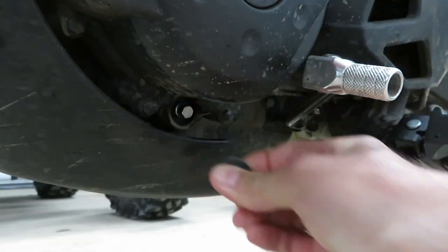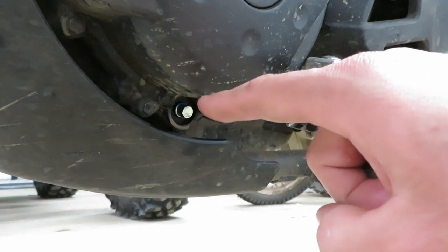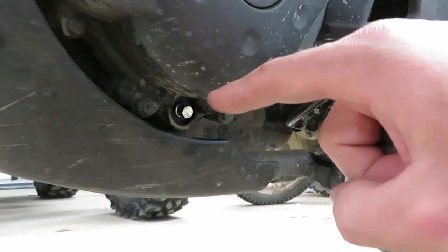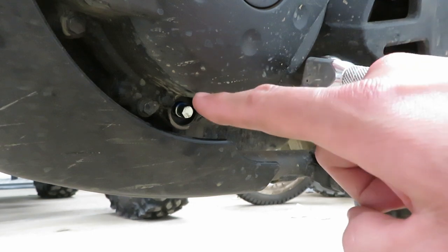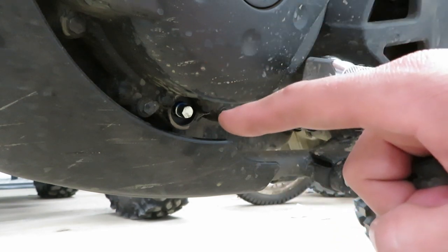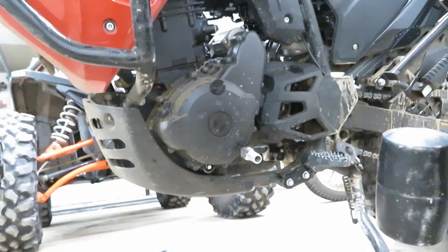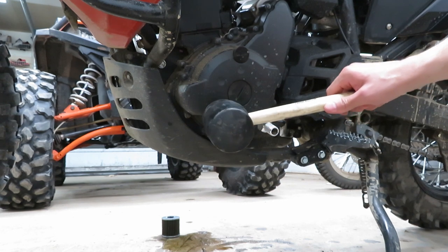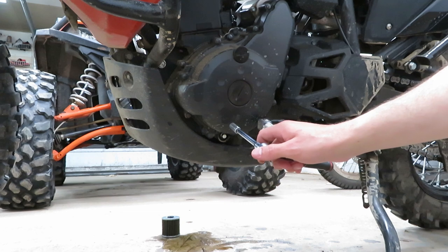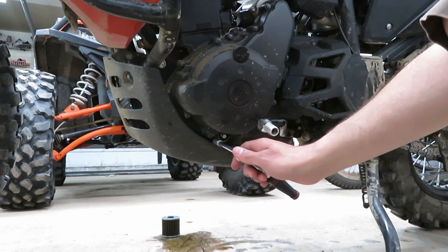Next is over by the shifter — there's a plug that covers a shiny bolt. That fastener holds your doohickey in place, and by cracking it loose it allows the spring inside to adjust so your balance tensioner is set correctly. There's a lot of debate about this on the internet, but doing this during oil changes can definitely prolong the life of the stock doohickey and the spring. With that loosened, I'm taking my rubber mallet and giving the case a few wraps to get things moving inside.